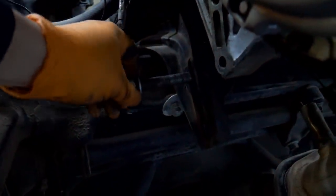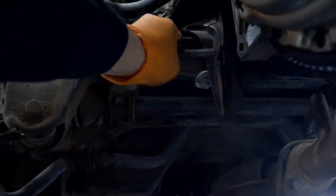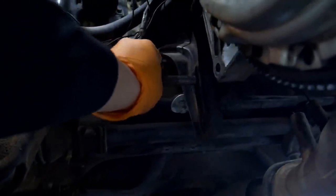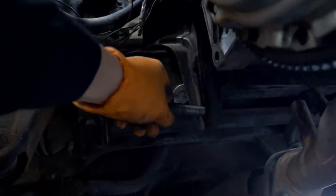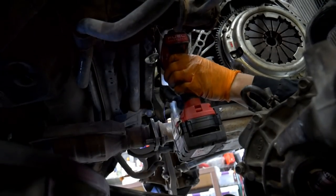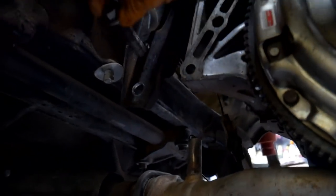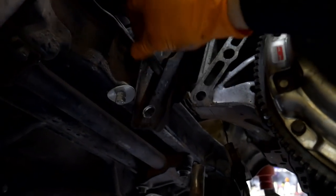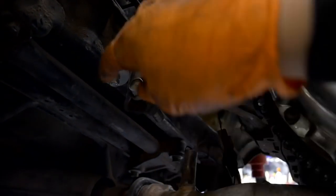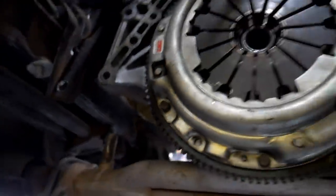That other T-bar I have was the one that came with a different transmission that I had. Someone had already drilled out the hole. So I don't think I'm gonna remove it. I think I'm just gonna get my drill bit out and open these up a little bit, that way I don't have to pull it off completely. And that went ahead and worked after just drilling a little bit. I can now fit these larger diameter bolts completely through it and bolt it up to that hydraulic transmission. All right, let's get this thing back on again.